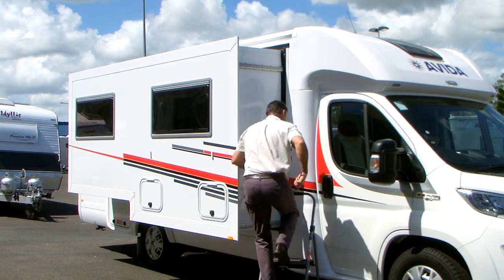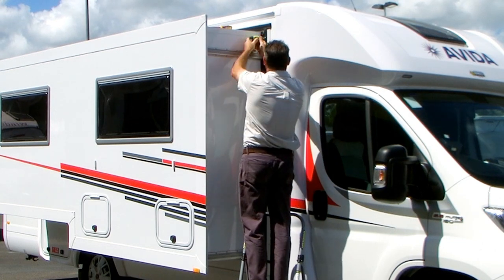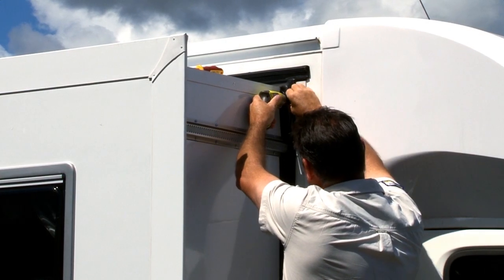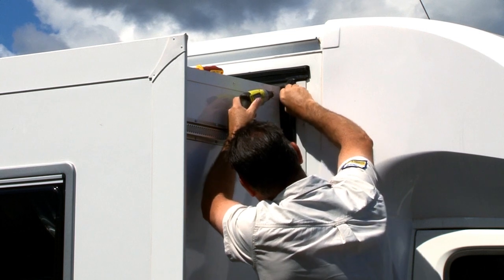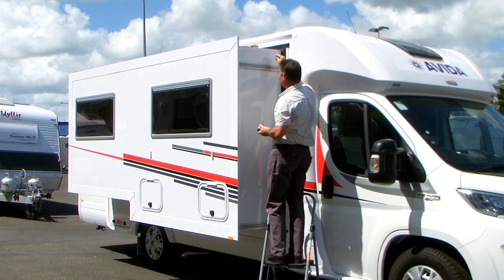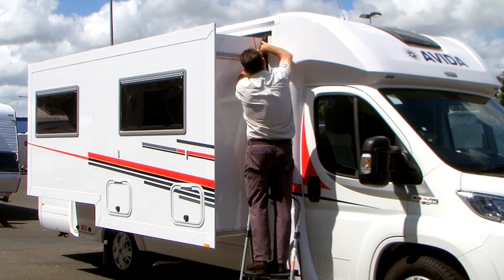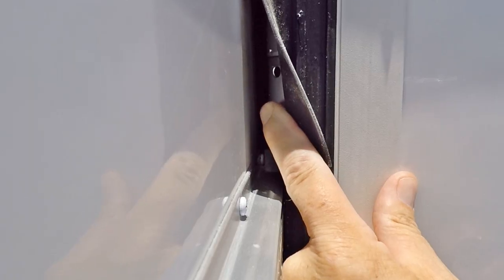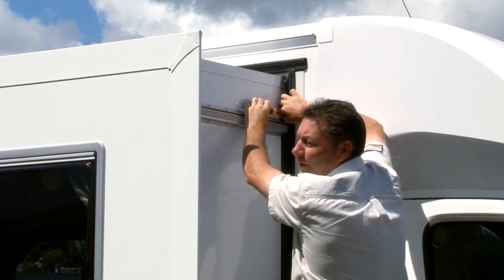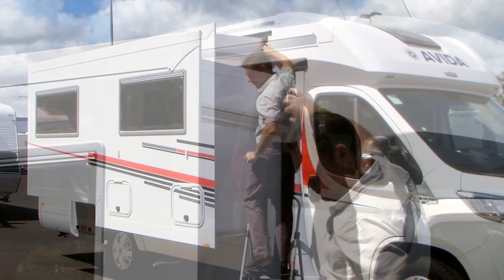So we're going to go up here. That's the little screw I was talking about — it just came out of this spot here, holding that motor in place. I just want to peel back this rubber, and in here is the motor. I simply put the blade under the motor and pop it up.